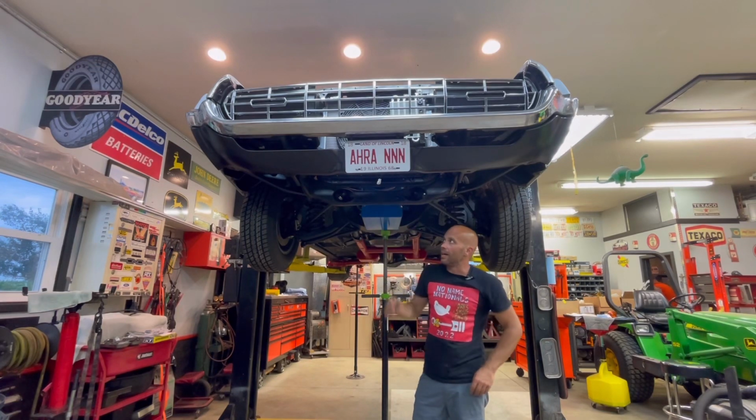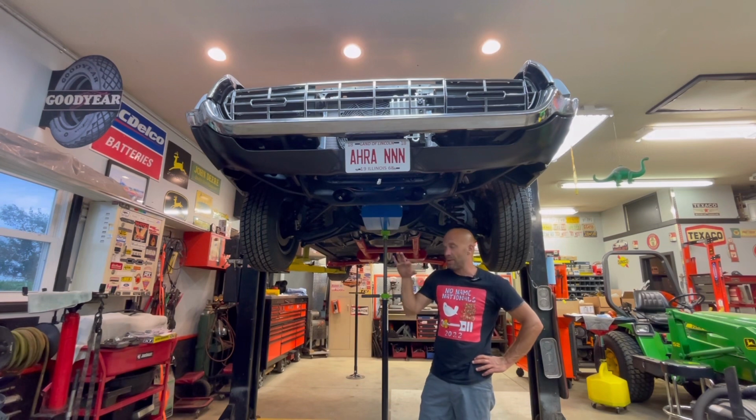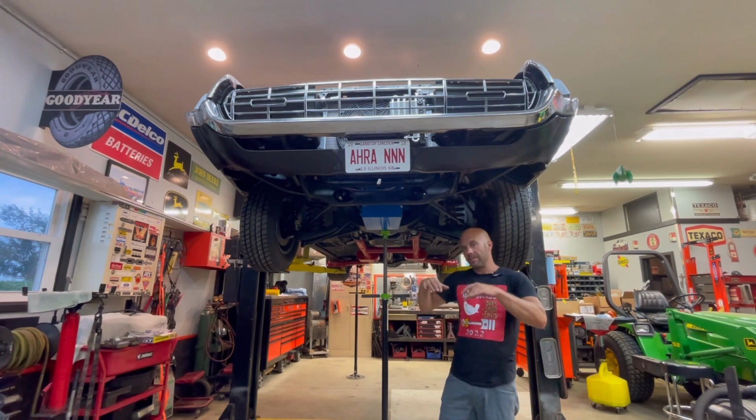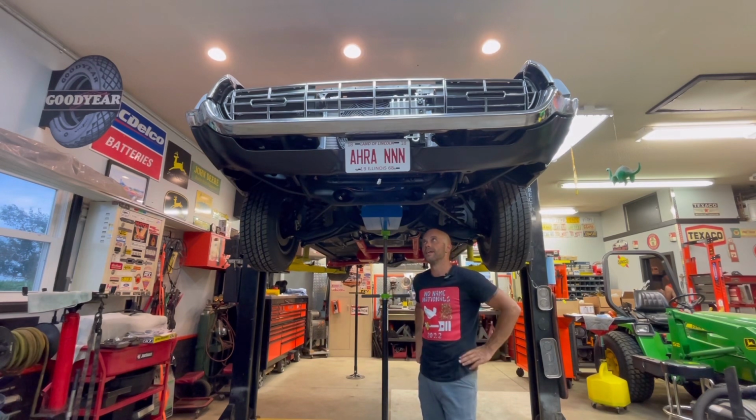That's it for tonight. It was actually a pretty good night. What we ended up doing is I bought some throttle return springs that are made for Holley carburetors to be used like on a tunnel ram or a blower. It's kind of neat how they work. They actually mount to the base of the carburetor. It's got springs. It goes to your linkage and snaps them back.